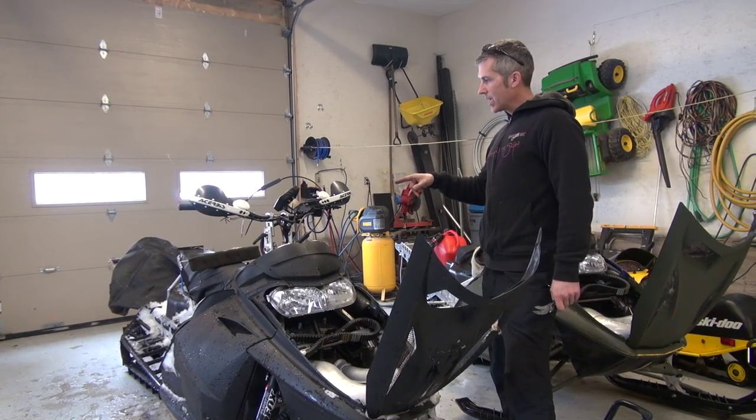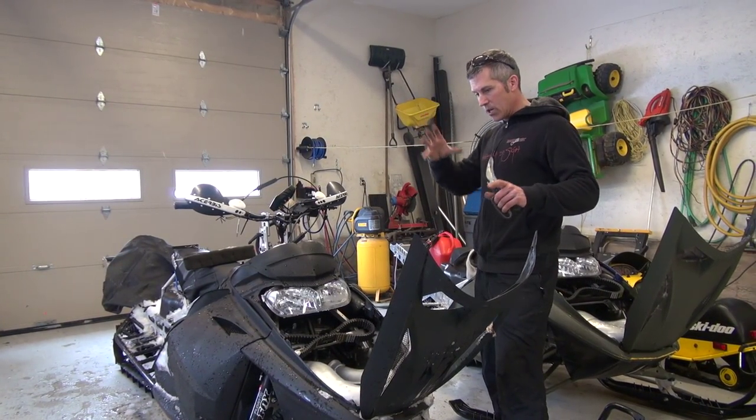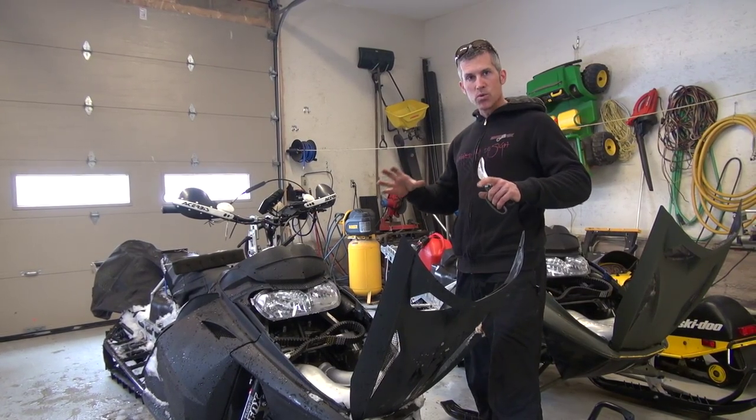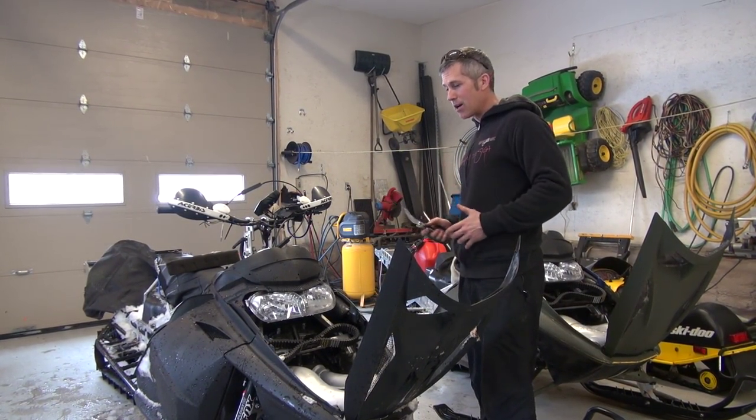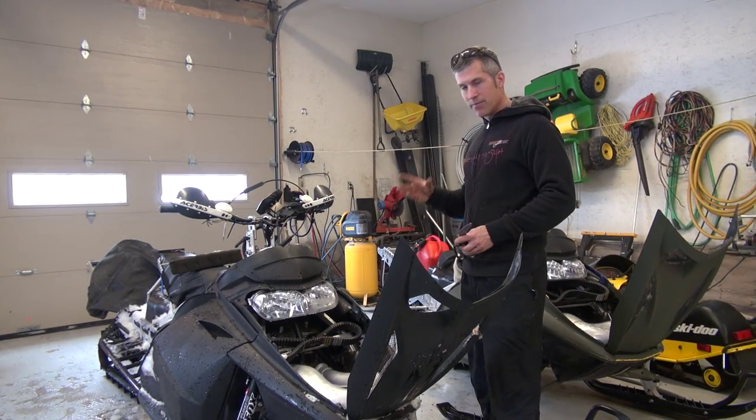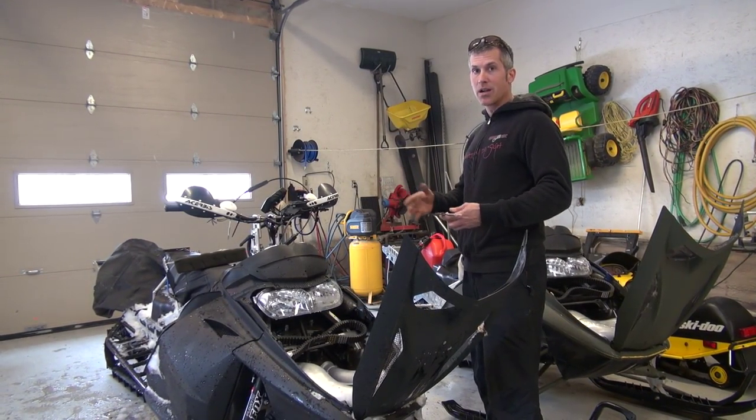When I was out riding it hard in the snow I took some videos. You guys are going to be able to see how it was running. The EGTs aren't coming up as much so it's running a little richer at higher RPM. It's just not getting the fuel burned and possibly the octane that it needs.